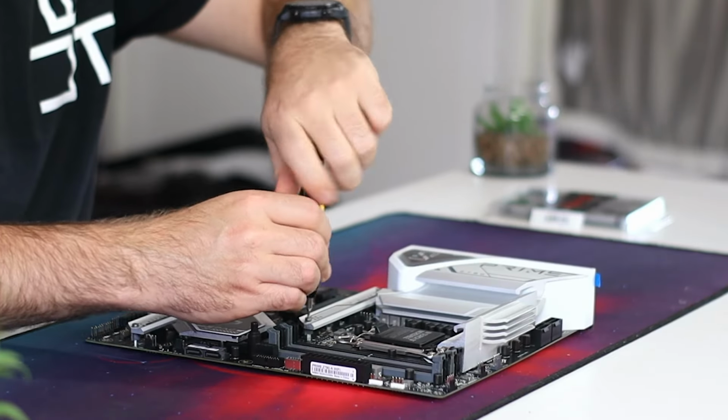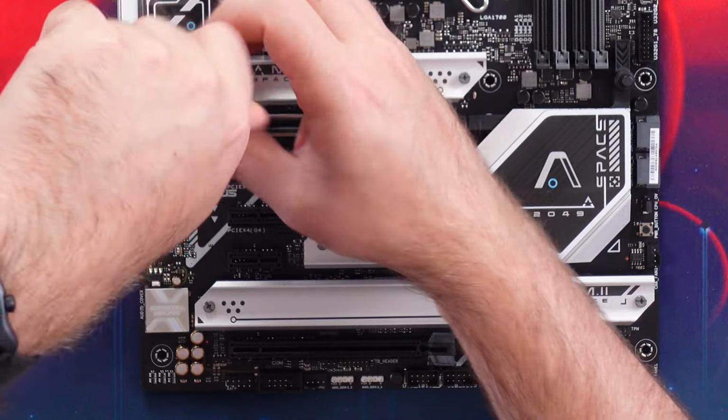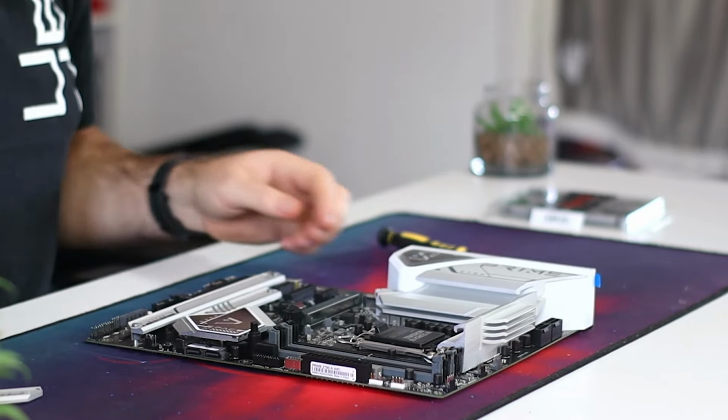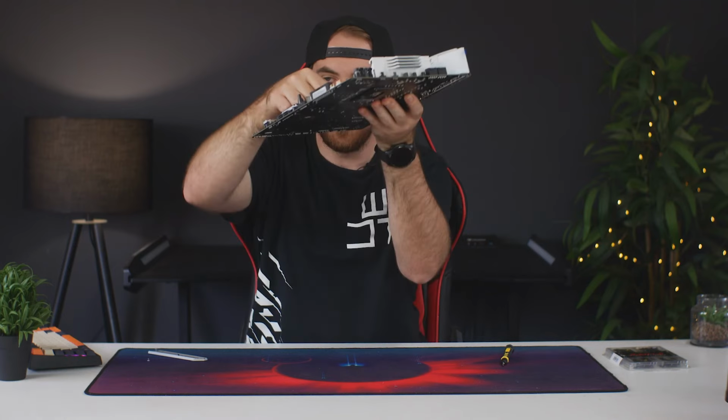Then moving on to storage, we do have a crazy 4 PCI Express Gen 4 M.2 slots, which we can quickly open up here, because they do also feature Asus's Q-Latch design, which makes it so much easier to install M.2s. Now I just need to get the last screw out. I do really love this, where if your motherboard is already installed in your case and you need to install a new M.2, this makes it so much easier, where you don't need to worry about the tiny M.2 screw falling off or getting lost or falling inside your GPU's radiator fins and so on.